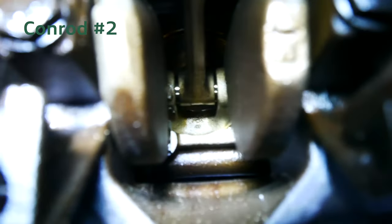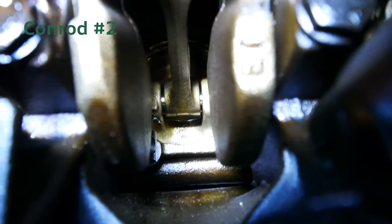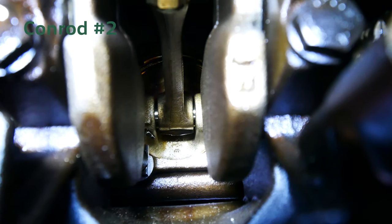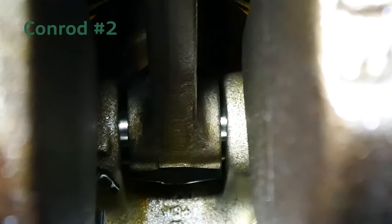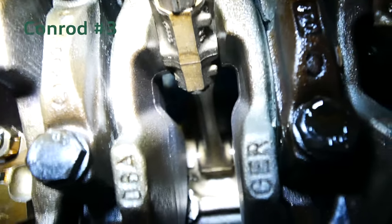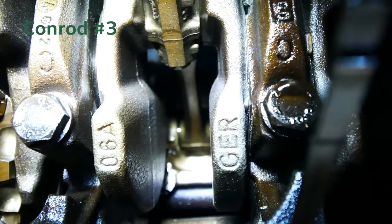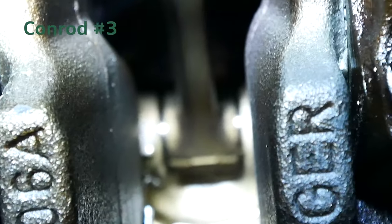Let me zoom in for you. On cylinder two you can see really well that the gap between the rod's small end and the shiny bits of metal on either side of where the connecting rod joins to the piston — actually looking at it really closely, you can definitely see it is not in the middle. So number two is definitely bent. The next one here is number three — you can see right up there that looks pretty center to me. That looks pretty good.